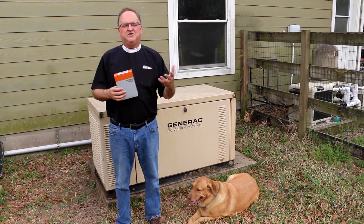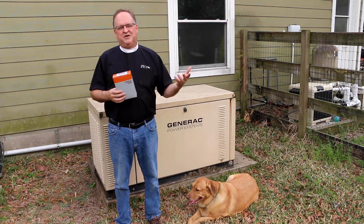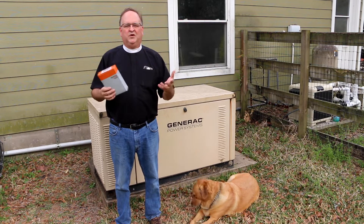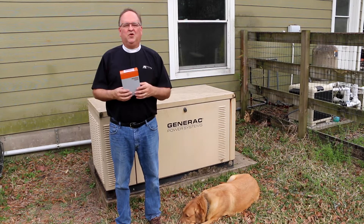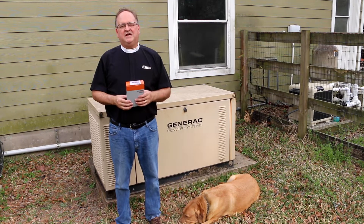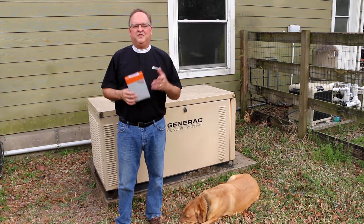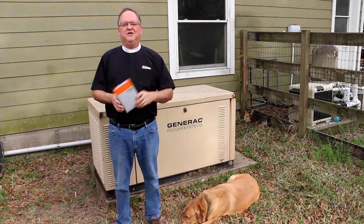Both conditions come from the same sensor, but neither condition was true. So I took the sensor out, noticed some debris built up on the probe, cleaned it, reinstalled it, and it worked fine. Recently, though, it started happening again and eventually quit working no matter what I did. That's when I learned that in 2009, Generac issued a product information bulletin about this problem with false low coolant level indications, and they made a retrofit kit to address it.